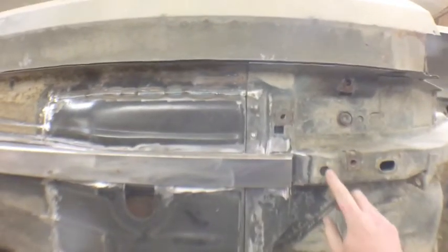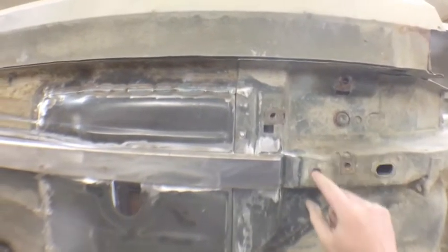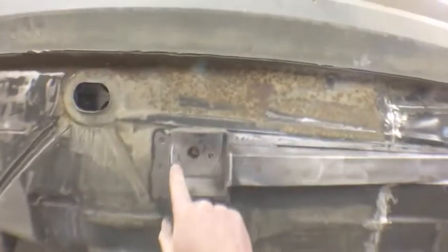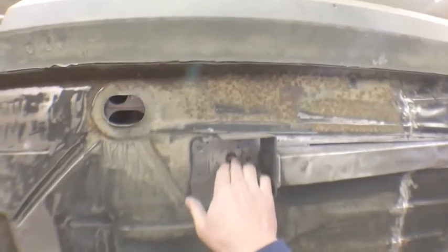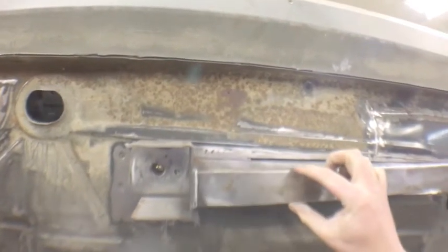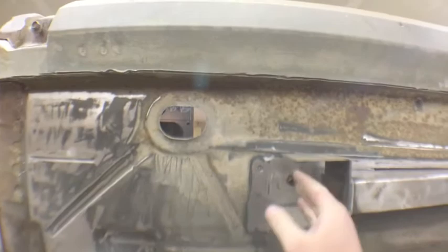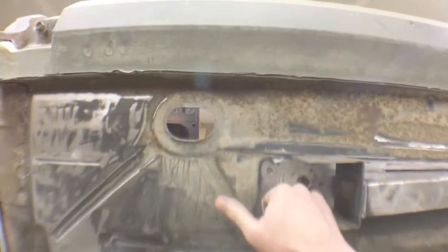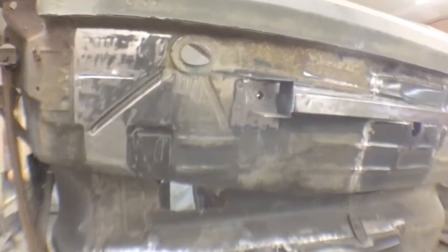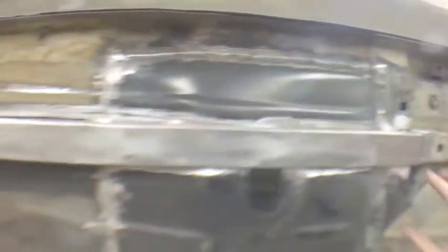For layout on these things, here's what I did. I actually took a string line, a chalk line, and I found center line, which I used off of this hole from the rear subframe that's actually spot welded into the car. That was my center line from the back, and obviously the center line in the front is the first attachment point on the rear of the subframe. I made a chalk line and measured off of center of chalk line to find the two outside edges of where the subframe connector was going to go through. When I had the frame in here earlier, I made some marks to get me a distance where I needed to go. That allowed me to get the cut exactly where I wanted and notched out to fit in here.